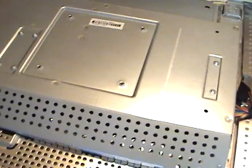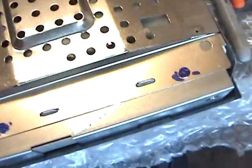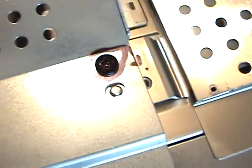Now we're going to get into the other boards, which are screwed on. Number 2 screwdriver. If you look, I marked the screws in blue. These are all the same size. One reason to mark them is you remember where they go. I also marked orange ones for the 2 small ones. Actually there's 4, there's 2 more you can't see right now. And the black ones marked there. Just helps remember where to put them back together if you're not used to doing this.